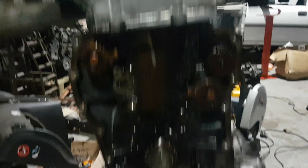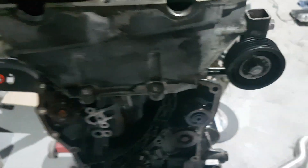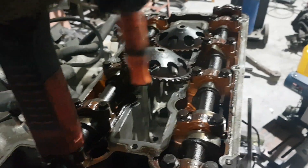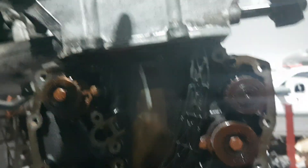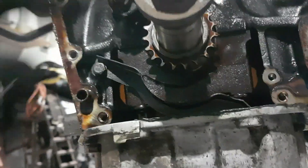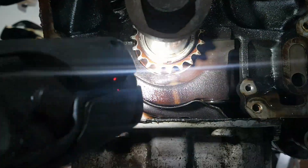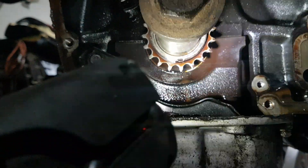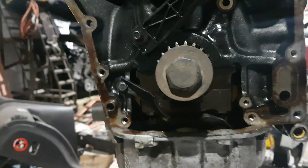What you want to do is take all the spark plugs out so you can turn the bottom end over nicely. What I tend to do is just put a screwdriver in there. Obviously then you bring your crank to TDC — the screwdriver should be fully up. So basically this woodruff key is right at the top, and then the timing mark underneath should be at BDC, bottom dead centre. Once they're all lined up, crank is all lined up.